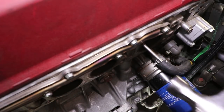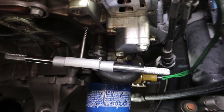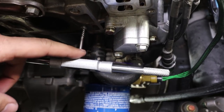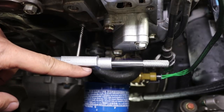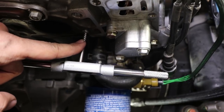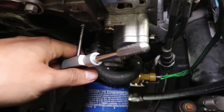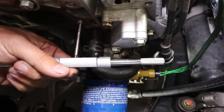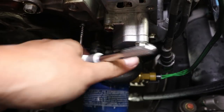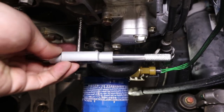What you're gonna do is tap that bad boy in. This is where I'm at currently. Let me get a close-up of that. I have the stud in here — it's not perfectly centered, but it did catch. I hammered in the reverse easy out. Now it's just a matter of turning slowly in order to extract it. It didn't come out as easy as you'd expect. I wish I had a ratcheting thing up here, and plus I'm holding the camera — this is for you guys.